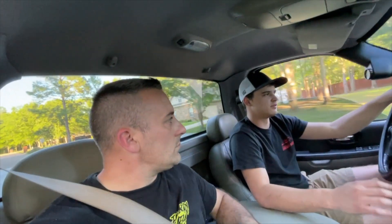They told me when I bought it that it's got QA1s on the front and Strange adjustables on the back, and they were all the way loose. I kind of just attributed the handling issues to that. When I took the wrinkle walls off and put these tires on it was a bit better, but it was still a little wavy. I always attributed that to the shocks being all the way loose. We tightened it up really tight for right now just to see how it was working, and we'll probably loosen the back up a little bit.